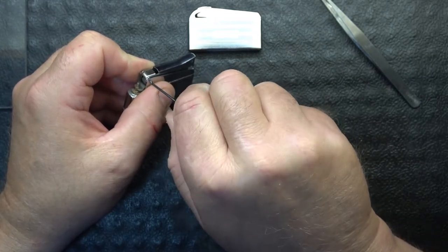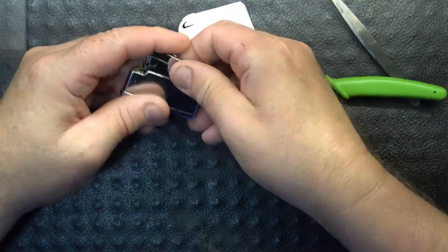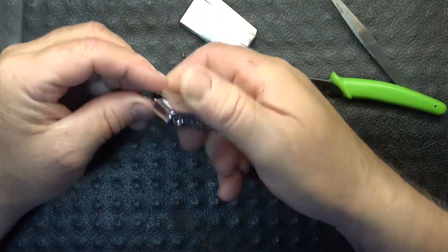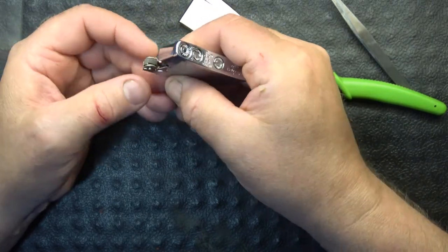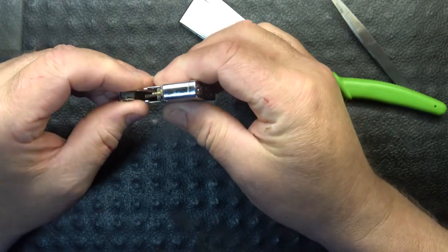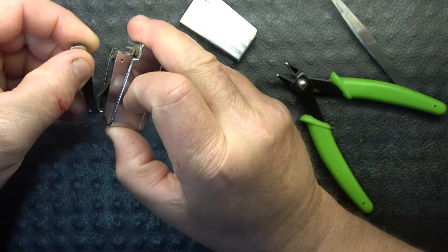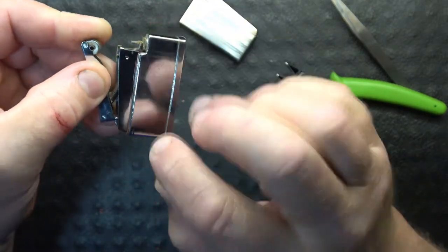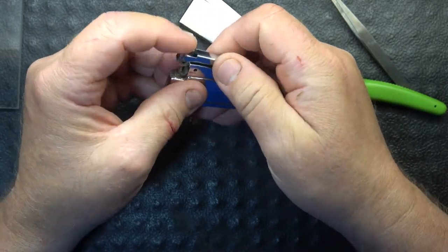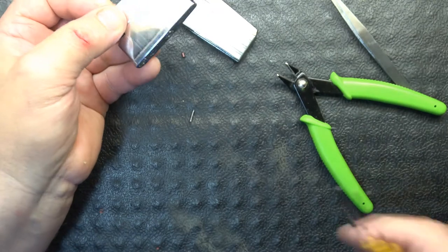All right. Now, you're going to have to get some wire cutters to pull that out with. Now you can see this here, I would just tape this in so this assembly doesn't come out. Once this little internal pin comes out of there, the whole flint roller spring assembly will come out. But I think you can possibly see that all the back spring and this other spring mechanism right here goes through this screw. So when you're putting this back on, well, I need to take out the flint spring.